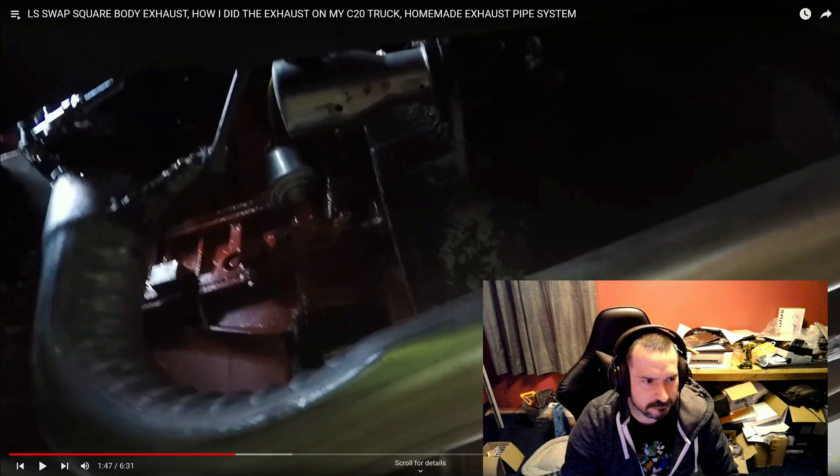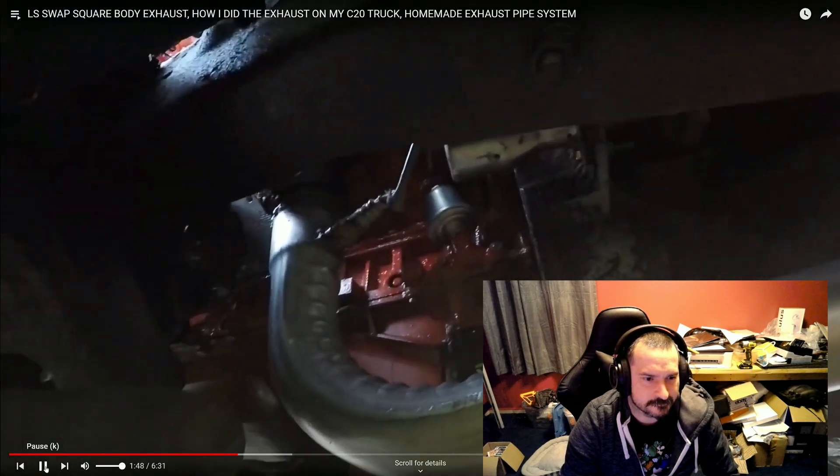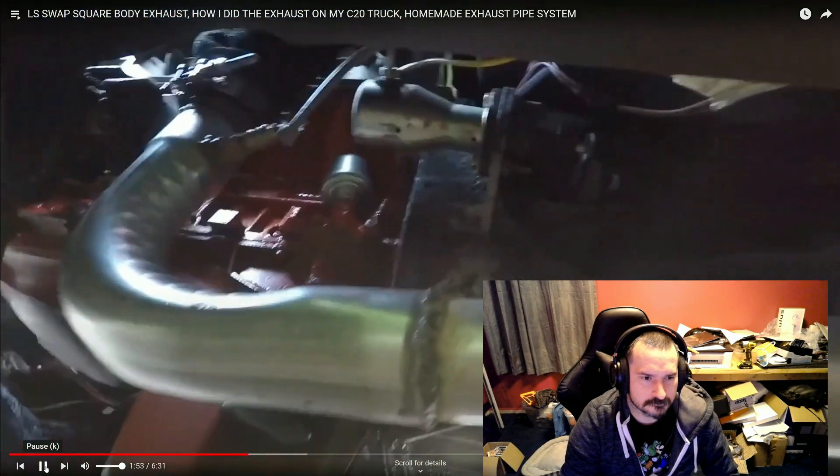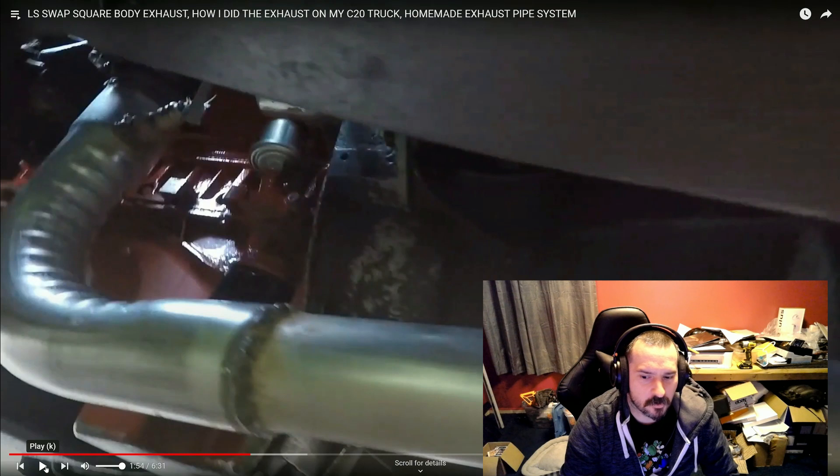It's just got a 90-degree from O'Reilly's here, and you can see why I welded it to the V-band. You can see it passes the frame cylinder — plenty of room. You see my oil pressure sensor right here on the side. I actually ended up having to put an aftermarket oil pressure gauge on this because it just wouldn't work with the factory one. The old gauges have a resistor built in and my resistors were bad, so it wasn't working, so I replaced the whole gauge.